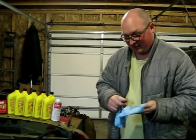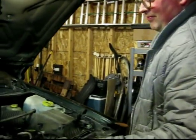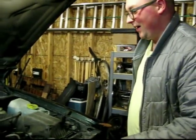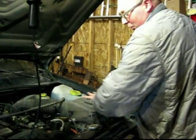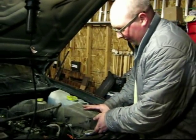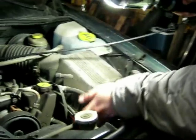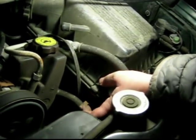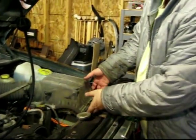First thing I'll do is the air filter — these are very simple to do. You'll notice in your car you'll have somewhere in here, like this is the first time I've ever worked on this but it's still pretty easy to find. You'll have a big box of some sort with a big hose coming off of it. This is your air box, and this is where the air going into your engine comes from. They usually have clips — just undo all those clips and this guy just lifts off.